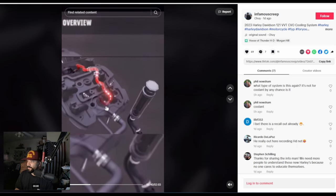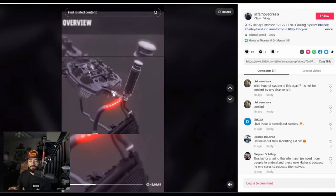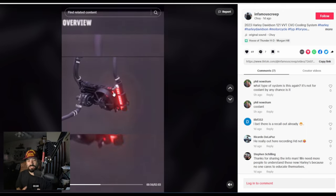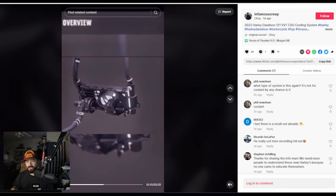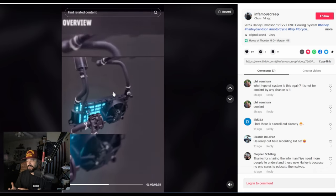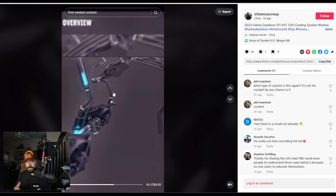The main passages on the coolant flow are around the exhaust valves — that's where most of the heat builds up. Your exhaust ports, the exhaust valves — you have intake valves and exhaust valves, and the exhaust valves are typically the hotter ones. On the front cylinder, that exhaust valve faces toward the front of the bike, so it gets maximum airflow. This is why the rear cylinder is the main focus.